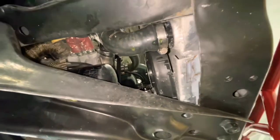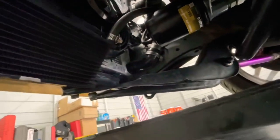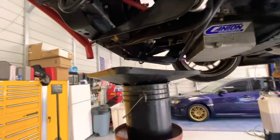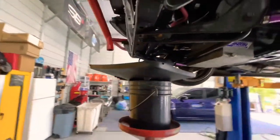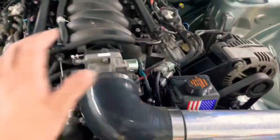It's also leaking from right here — I think that hose is slipping off, so let's fix that also. First we're going to drain all the coolant from the radiator and the system. We're going to remove the hose from there and drain all the fluid into this bucket. Very fun time guys — getting squirted everywhere. But we're getting the drain done.